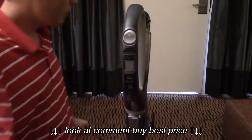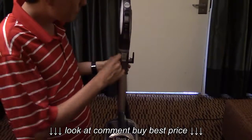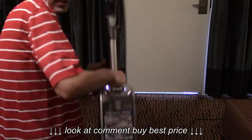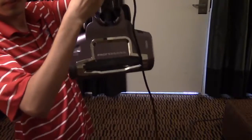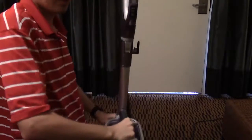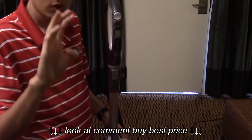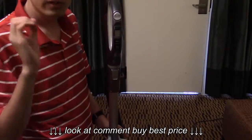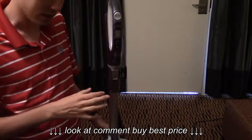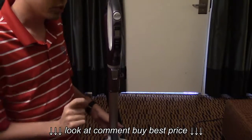After you've made sure that you're on the correct setting, let's check a couple other things on the vacuum. If you're vacuuming carpet, put it in the turbo or carpet setting, turn the machine on, lean it back, and check the brush roll indicator. It should be green. If it's red, there's probably something clogged in it — in which case, disassemble the vacuum like I showed earlier, take a quarter, and check to make sure there's nothing stuck inside the brush roll and that it can turn semi-freely. If the brush roll is stuck, or there's nothing stuck in there and the light will not turn off red, you need to call Shark and they should replace it for you. You have a seven-year warranty. If the light is green, then we're going to do a little bit of disassembly and check parts of the vacuum to make sure everything's working properly.